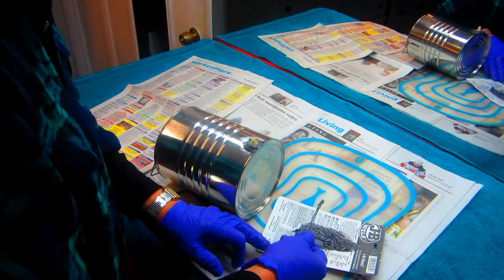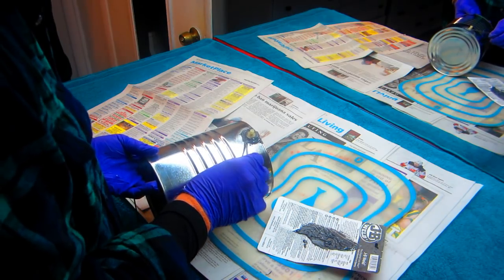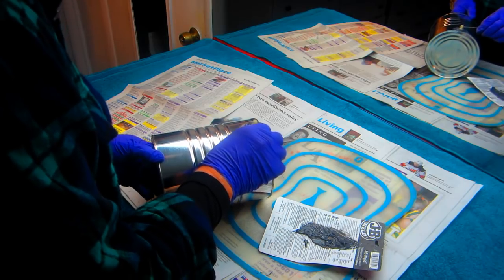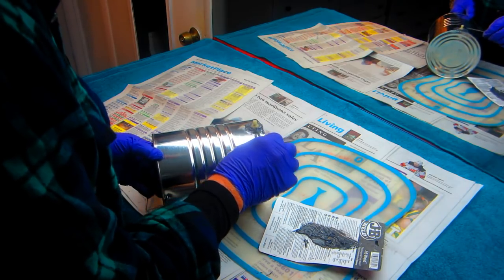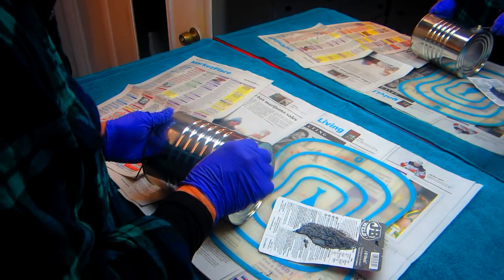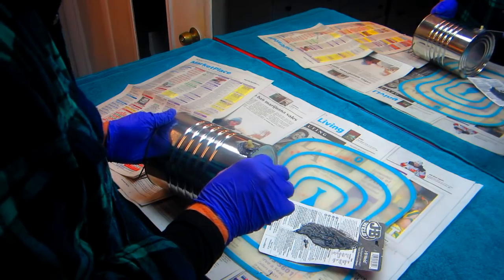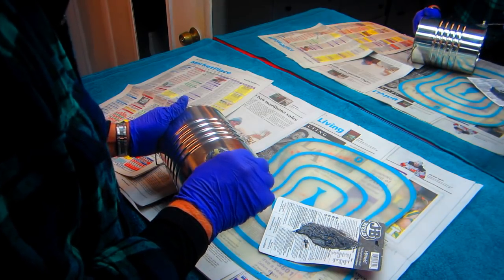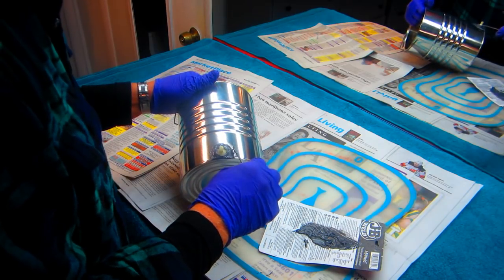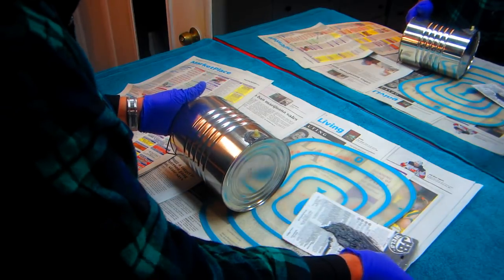And then I'll show the last little thing on this. When we used to make, and I made many of them, two-cycle exhaust systems for model planes, currently known as tune pipes, I always put the fittings in with JB Weld. I don't recall even one of them failing of the hundreds that I made. But again, a two-cycle engine does run cooler than a four-cycle.